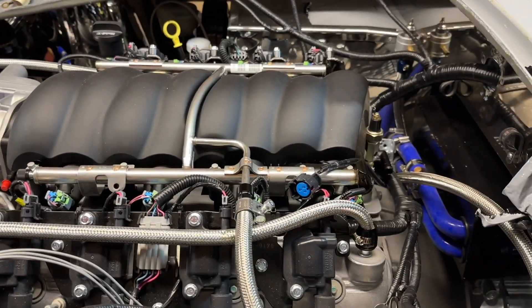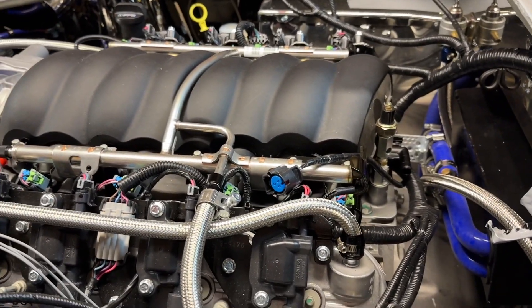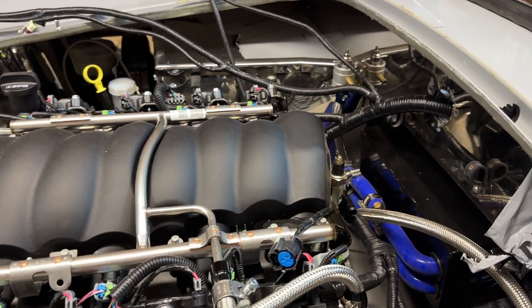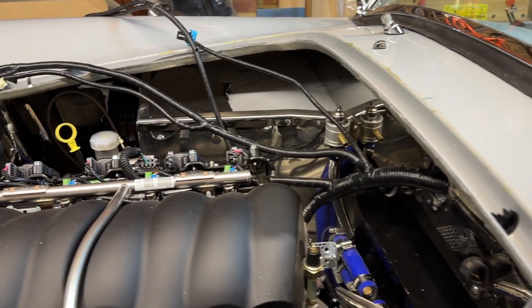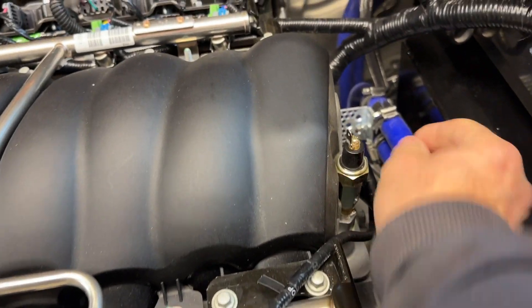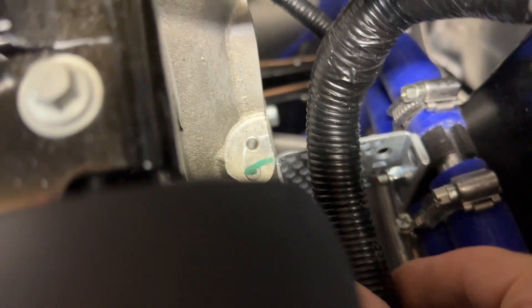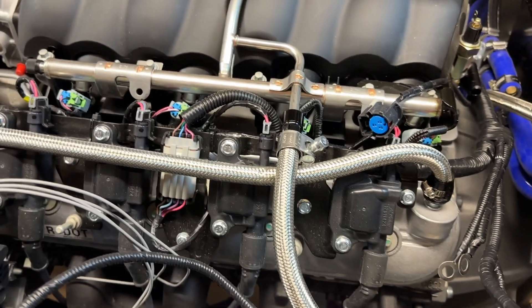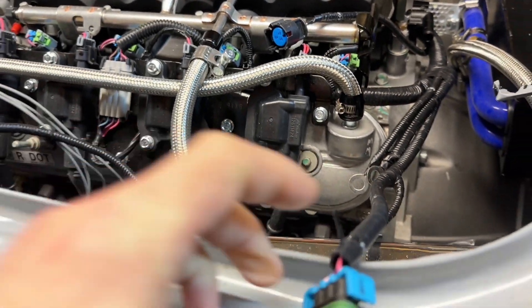New day — spoken to Canems, fantastic support as always over my previous cobras. The loom is fairly tightly bound and is heat rated so it can go against the engine, but he says to mount some P clips to bring the loom away and give it some airflow. There are some large earths here — great — going to a clean earth spot. There are great M10 holes on the back so they'll go there.